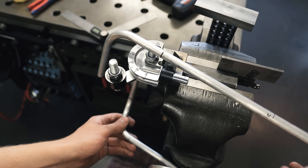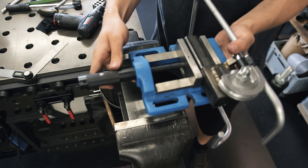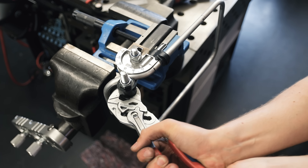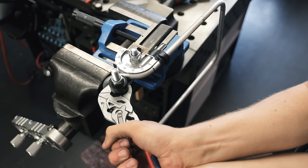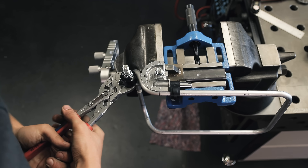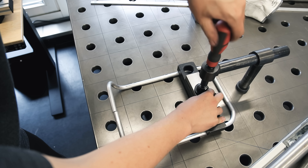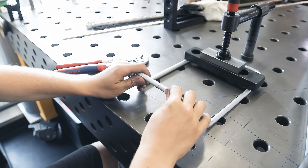So now I can finish that bend in the rack, and then I have to do the same thing on the other side — which presented a new issue since the rack now collides with the vise. I had to mount it in a different position, and it turned out to be really tricky to find one that gives me enough clearance. Eventually I ended up with this 'viceception' setup — I can't even count the amount of improvising that's in this shot — but it did allow me to finish the last bend, and despite a small misalignment on the end, it came out pretty good.